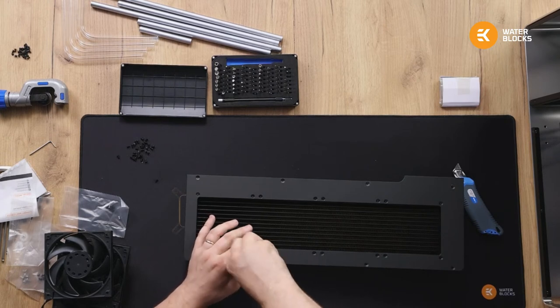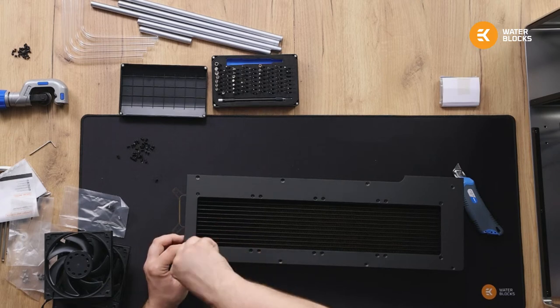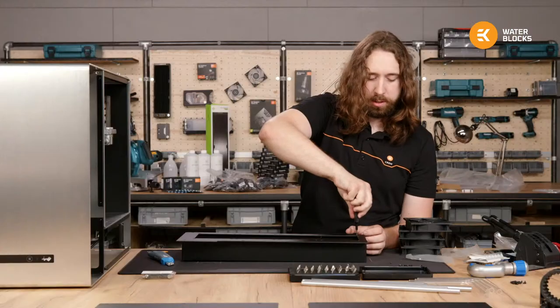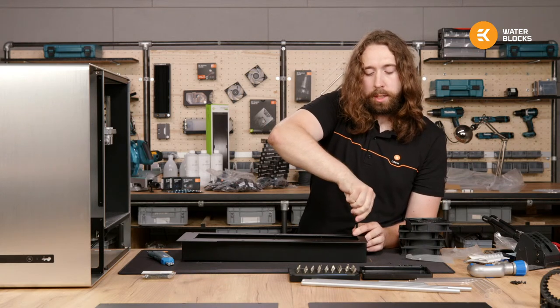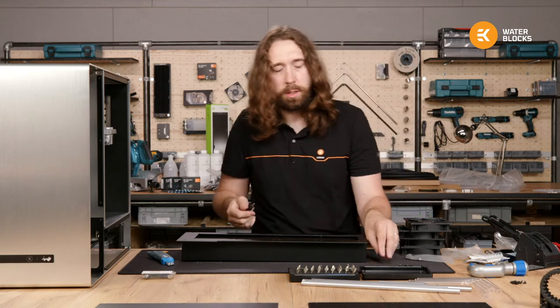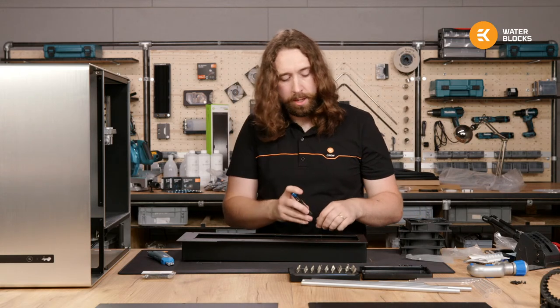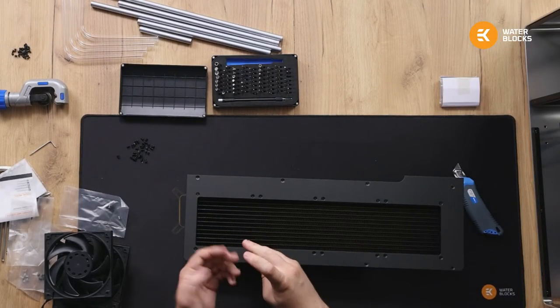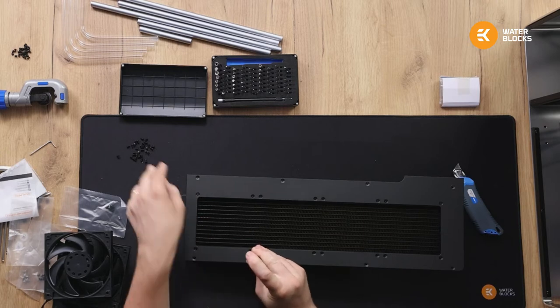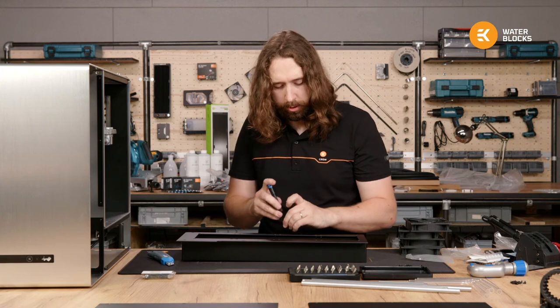So in respect of 24-hour operation, not caring about how it looks underneath acetal, copper is the most durable. Nickel is basically used so that it looks consistent, that after a year or 2 years, it won't change color. It's a bright finish and it remains a bright finish. You can clean it, and if you look after it, I'm sure it will last as long as the hardware.